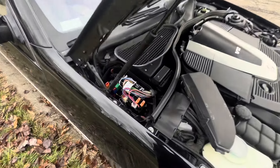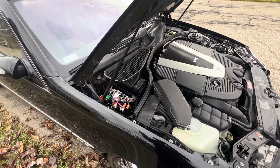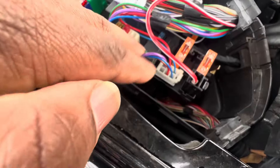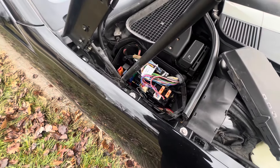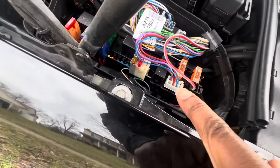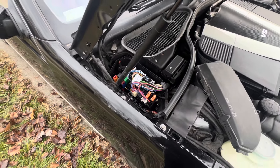The first thing I did was go to the starter relay — this green one right here. I had a couple of those so I swapped them out, but nothing changed. Then, based on a video I saw last night on YouTube, I tried to figure out if a signal is even going to the relay. This purple wire and plug is the source, the 12 volts that goes to the starter relay. There is no voltage present when you turn the key to full crank attempting to start the car.